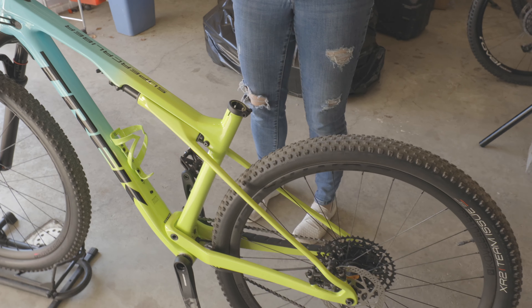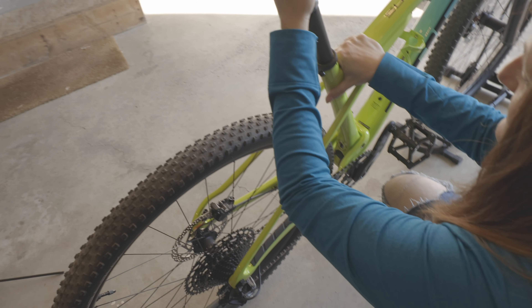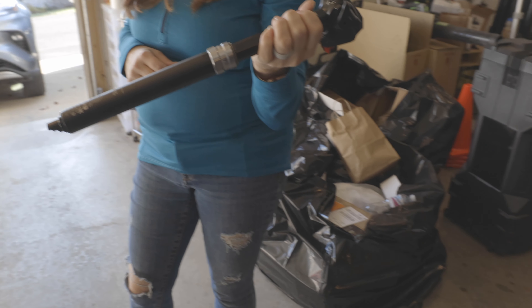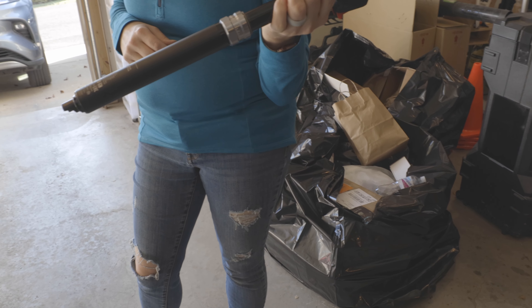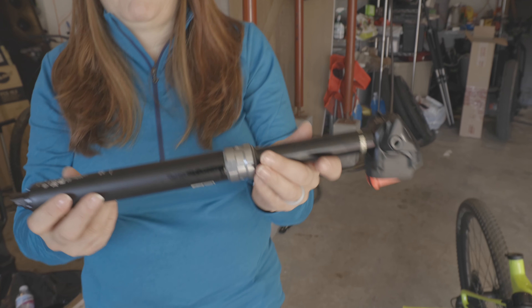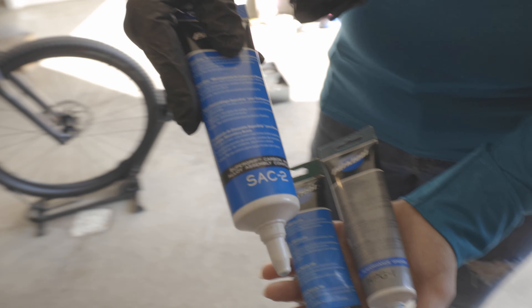Should it be greased at all? Actually it should. What we're going to do — you don't really need to, but if you're a bigger person like myself, Jerry would probably need to put carbon grip compound on the post so it gives it more grip. It's like putting a light coat of sandpaper on the post. If you're a bigger person you're going to need it, because otherwise you hit a pothole and it could knock it out of true.